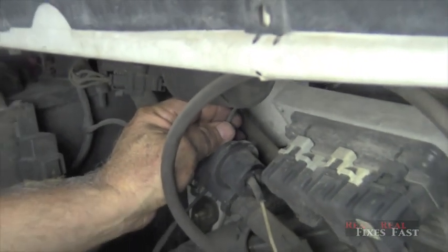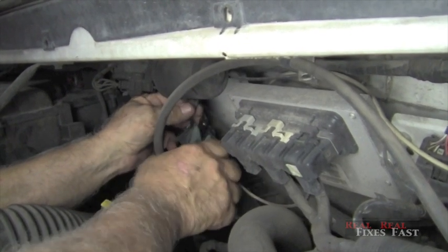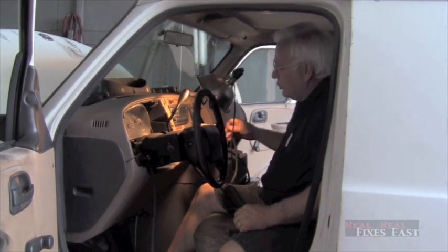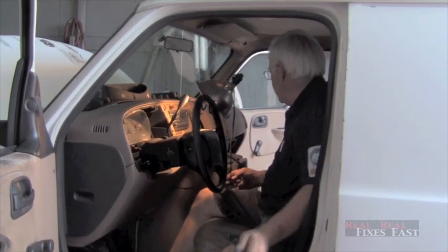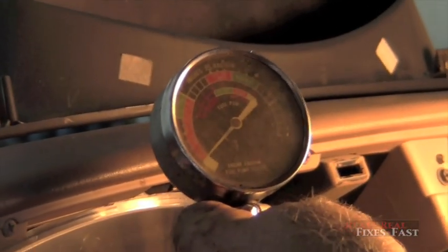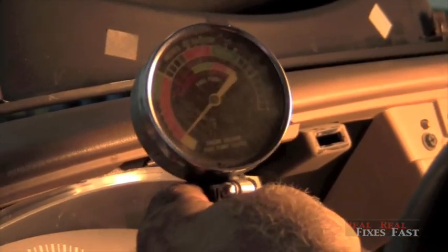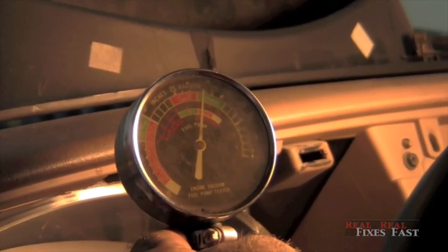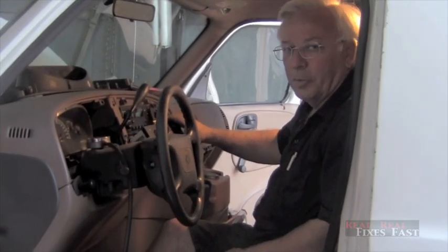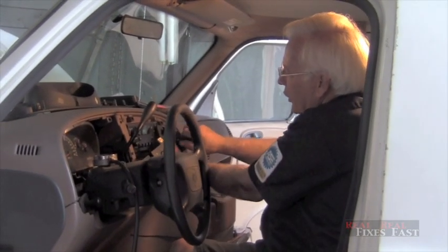We're going to snip that, cut the bad section out, put in a piece of vacuum line. Now we're going to go back around to the front and see if we've got vacuum now. I'm going to take my smoke lead out of here and put my vacuum gauge in. We're plugged right back into the same vacuum line we were before — this is intake vacuum — we start the truck. Now we're reading normal vacuum, where before we were only reading about three or four pounds. I hooked my vacuum line back up, I've got good vacuum. When I change the positions, I switch from the defrost to the vents to the floor. A little hole in the plastic vacuum line was the problem.